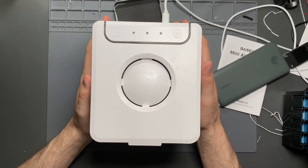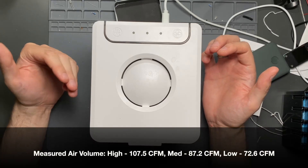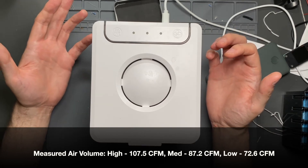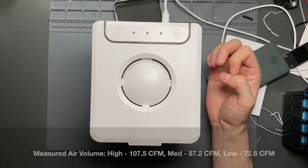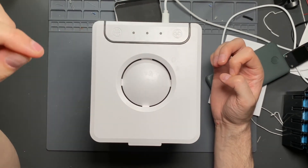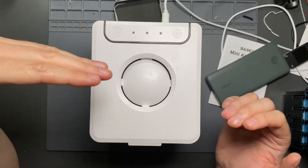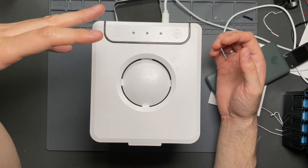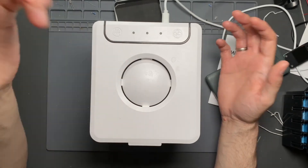For fan performance: on the highest speed I measured 107.48 cubic feet per minute, on medium 87.15 CFM, and on low 72.6 CFM. That's about 10% lower than the Arctic Air Ultra, which I think is due to the circuitry changes that resulted in almost 38% lower power consumption. The 38% reduction in power is really quite amazing, and having airflow only reduced by 10% is really not that noticeable.